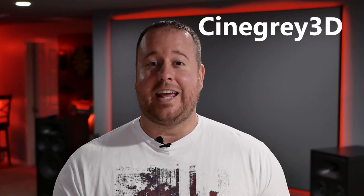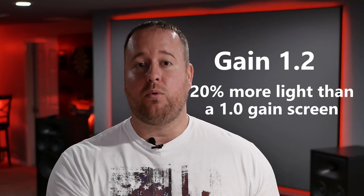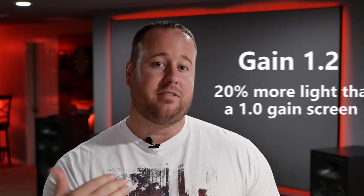After having the screen in my room for several weeks, I've been pretty impressed with its overall performance. Let's talk about the CineGray 3D material. As I mentioned earlier, it's an ambient light rejecting screen that has a gain of 1.2. When industries and companies talk about gains of screens, they're talking about the amount of light that is reflected back to the viewer. The industry standard is 1.0, which is the amount of light reflected back when shown on a piece of magnesium carbonate — essentially a matte white screen. If a screen has a 1.2 gain, that means it's reflecting back 20% more light than the 1.0 gain screen, so this screen has a slightly higher reflection rate back to the viewer, thus a higher gain.